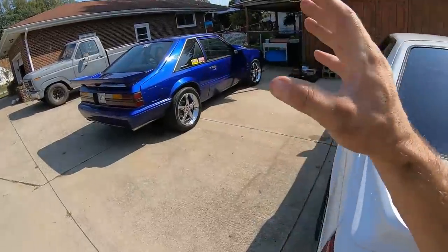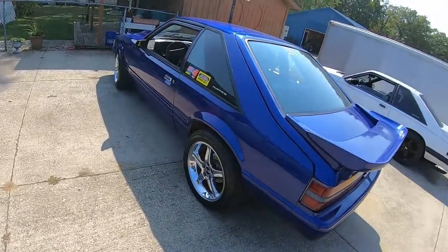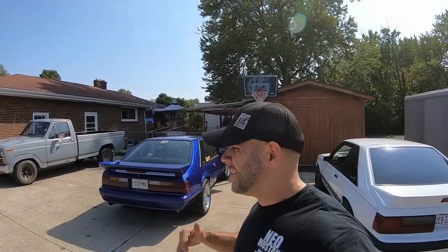What's next? To make any more power with Dad's car we need to convert it to mass air — that's pretty much it. At that point we'll be getting the Quarter Horse ready, the A9L ready. We have the extra parts for the car — the mass air, engine harness — switching it over, which could be a whole other series of videos. I'm not going to stick GT40 heads on it at this point without doing those mods first, because we just ran an 11.90 with 19-pound injectors. Anyway, I appreciate everybody for watching. If you like my Fox Body content, hit that like and subscribe, hit the bell for notifications. Special shout out to all my club membership — I appreciate the support. Thank you for everything. See you soon.